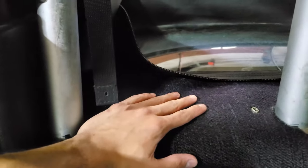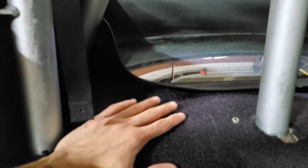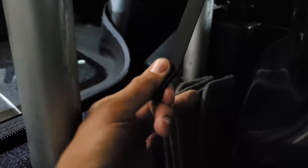While getting excited about securing the rest of the top up front, I realized I completely forgot about the window support straps again — I still need to get the rear stays off to get that slotted in place. At least securing the sides didn't require that. I also still have to get the strap slipped through on the other side. Before doing that, I'm going to get the headliner in place — it just velcros up against here, and this loop goes into the second bow, and the headliner wraps around and covers the third and fourth bows and comes up to the second bow.